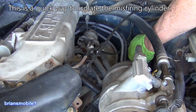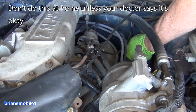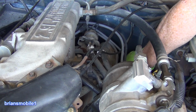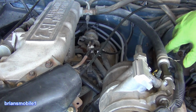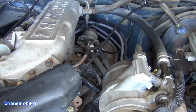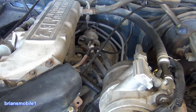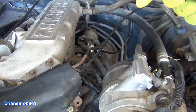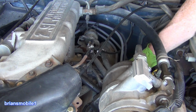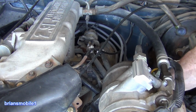When you take the spark plug wires off to test for misfire, you pull it off, and there's no change. I've got that spark plug wire all the way off, sparking on the side, and it's still running. I couldn't figure it out. You need air, fuel mixture, spark, timing, all that kind of stuff, and if you're taking away spark, it should misfire. But you pull the next one over, and it does the same thing, but just on this bank.